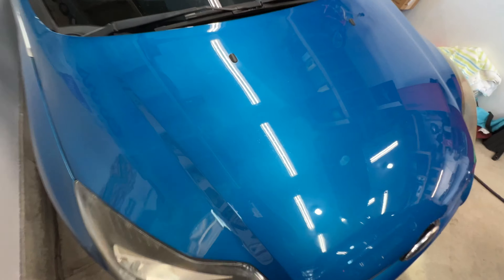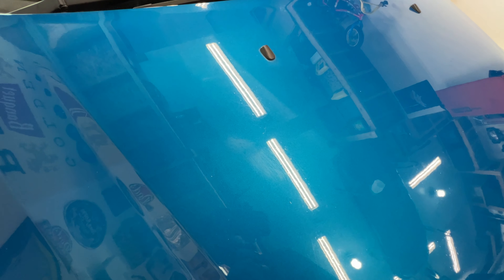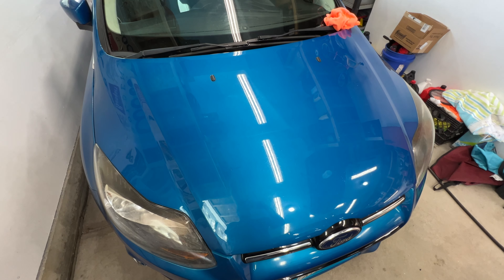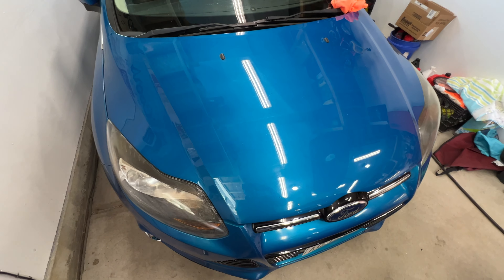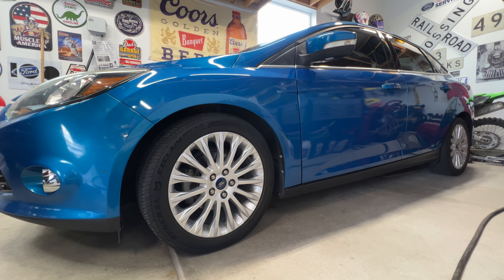I got the hood all done. You can still see the scratch right here — it didn't take that out. But like I said, that could be because of the product I'm using; if I had some cutting compound I might get that out better. Overall it's doing what it's supposed to — polish the paint. The battery is still going, so I'm going to do a little more on this car. Actually, I'm going to try to shine up these headlights and see how long this battery lasts.